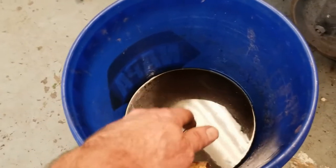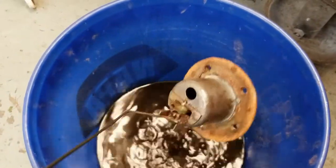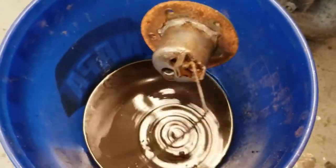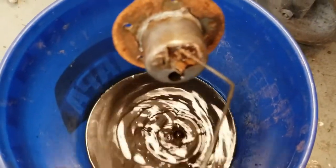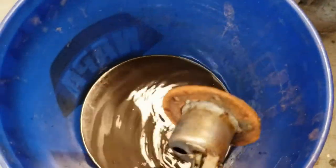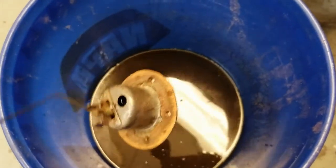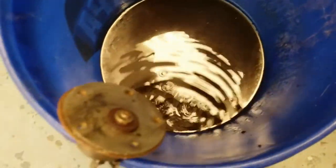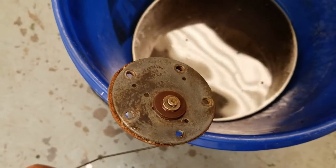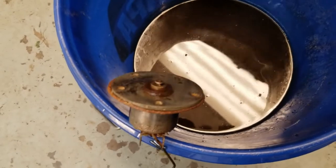The sending unit has been soaking for a while and it's cleaning up nice — it just helps to get that rust and sediment off. I'll check it with an ohmmeter just to make sure, but it was looking good in the car. I'll make sure the range is still good. Maybe clean that up a little bit on a wire wheel, but she looks good and is ready to go back in. It's been a pretty good day.